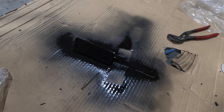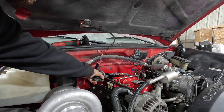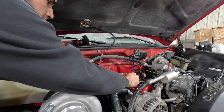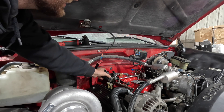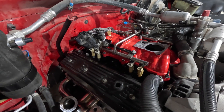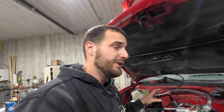Bracket's done. We'll let the paint dry and then bolt it on. I did a couple of trial fits and everything looked good before welding it up. It's not quite in the factory location, but it's close enough that the coil wire and wiring harness should fit without having to stretch anything or make it look weird.